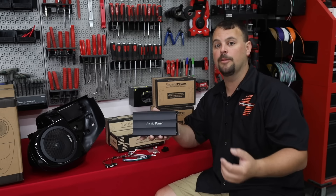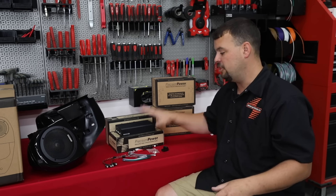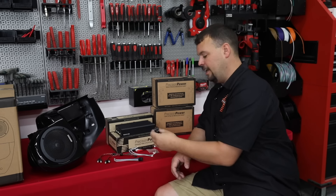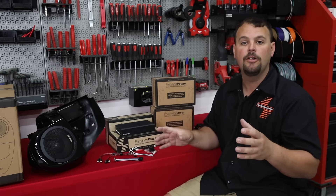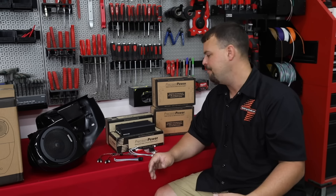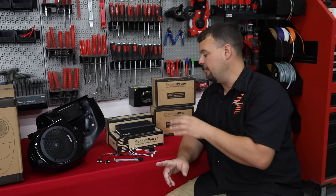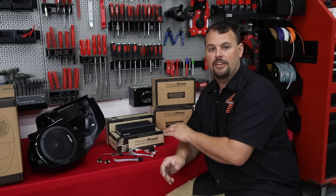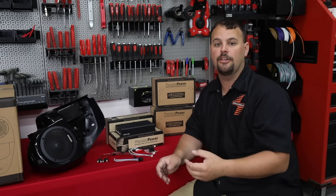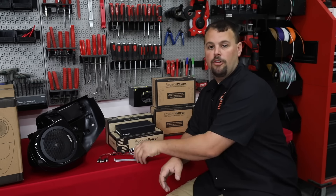Most of our high-powered options now in the motorcycle world are very high distortion also. The other thing that excites me about this amp is it's available in a couple different ways. You can buy just the amplifier, and it's going to come with high-level inputs and low-level inputs, along with speaker outputs and a power and ground connector — a universal setup to put it in anything. On the end of the amplifier, we also have a built-in high-pass or low-pass filter, gain adjustments independent front and rear, and all the settings to go from high to low input. At Volunteer Audio, we always go high-level in when we do a Harley installation, because we feel like RCAs or low-level in introduces a lot of unnecessary noise from LED headlights and the electrical system in a bike.